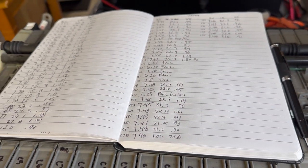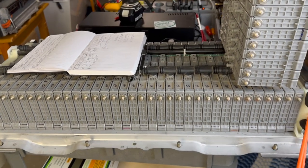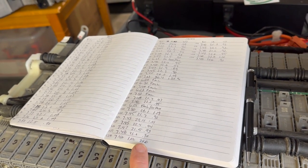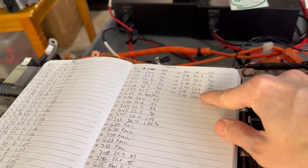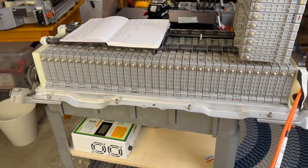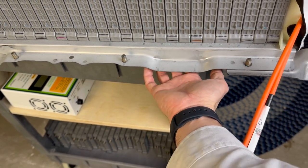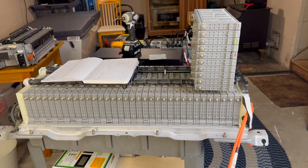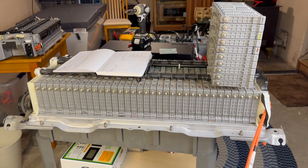I think they're going to recondition okay, and based on what I saw rebuilding that pack over there, I believe we can make this pack perform really well, even despite those numbers, because realistically their internal resistances aren't so bad that I'm really worried about it. 23 and 22, that's pretty much where, if you look at the rest of the numbers, we're right in those ranges anyway. So I'm going to swap in those now. This is a tedious process if you've never done it before. I have to unbolt all of the little 8 or 6 millimeter bolts on the underside, on both sides, and then pull all of that apart. So I'm going to do that off camera. It's not something that needs to be seen. If I feel there's something important that will help you rebuild your pack better, I certainly will tune into that.